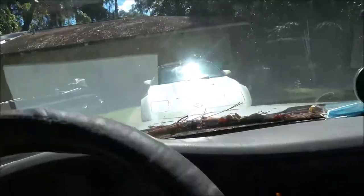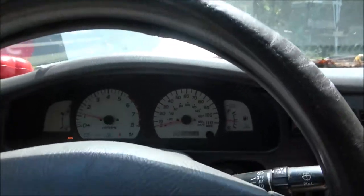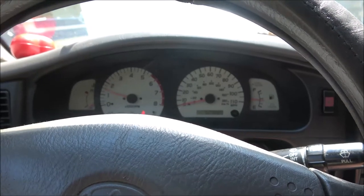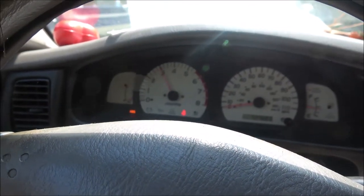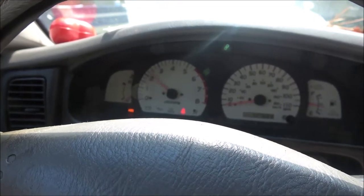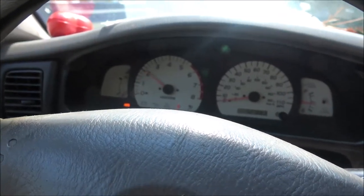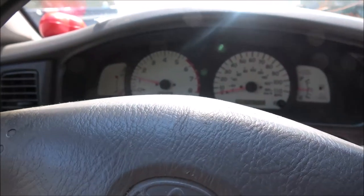All right, we're here now. Let's get under this thing. At higher RPMs it runs fine, but if you stomp on it, it's got that hesitation — it doesn't like going up hills or anything like that. All right, let's get under this thing and change these bushings.